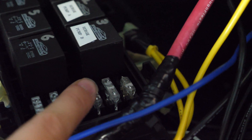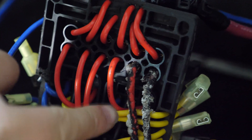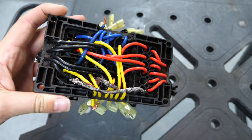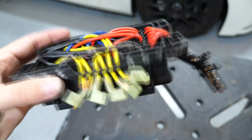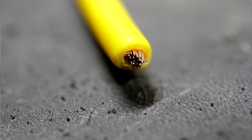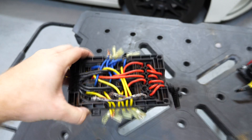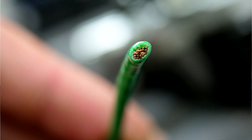After a short inspection I found the problem. The two pump relays on the right side have slowly begun to melt. More seriously, the power wires leading from the battery down to those two relays appear to have started to melt or chemically react. After looking into it — and taking Eugene my tuner's advice — these wires are copper clad aluminum. The center of each wire strand has aluminum in it, so the current-carrying capacity, even at 12 gauge, is closer to a 14 gauge wire.